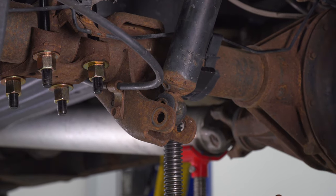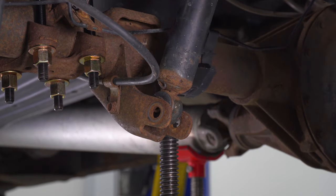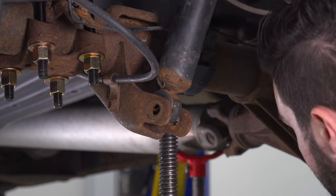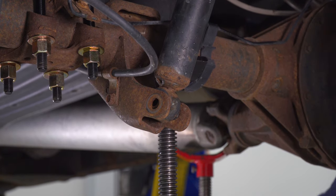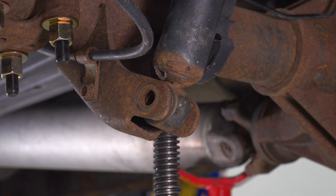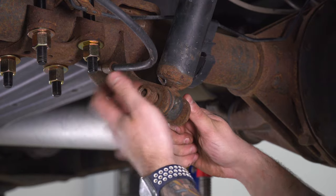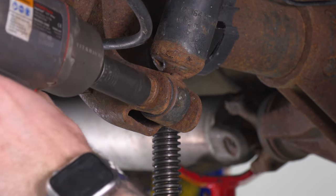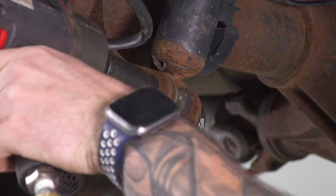Next up, we can focus on our shock. Jack up the rear axle enough so that the bolt holes line up. Keep an eye on the other side and the driveshaft — if it's drooping, correct that. Grab your factory bolt, put it back through, and tighten it down. Grab your 21 socket and wrench and tighten down your bottom shock bolt. Once you knock that out on both sides, make sure you're looking up the appropriate torque specs for your specific model and year range, and torque down all your bolts, then get an alignment and you're good to go.